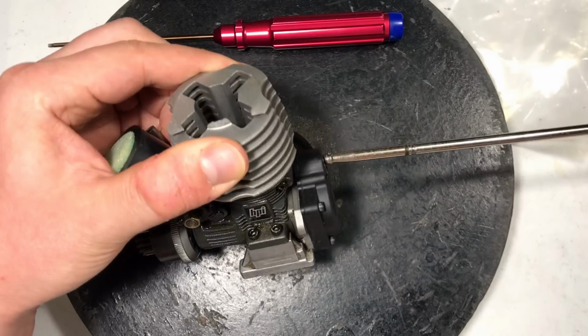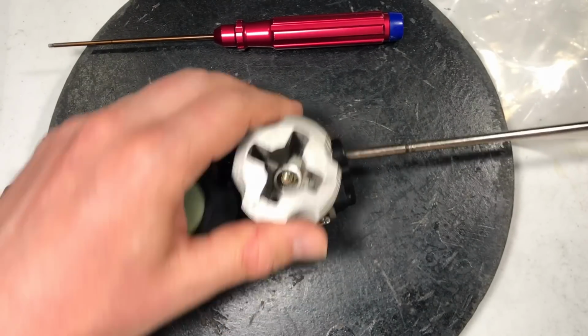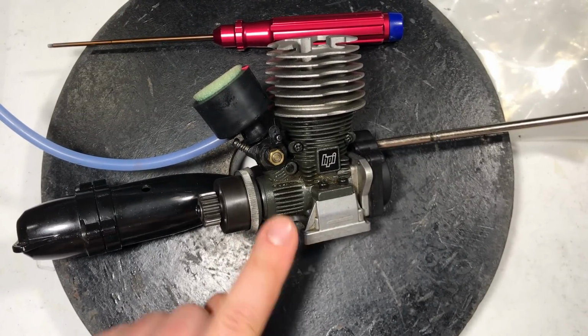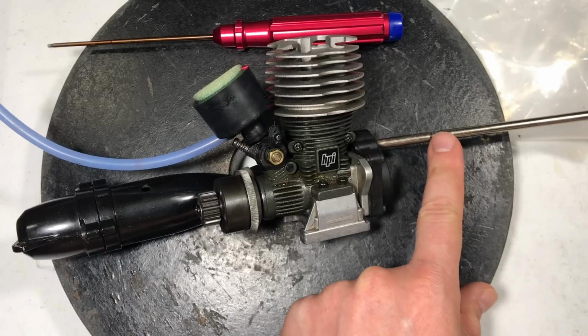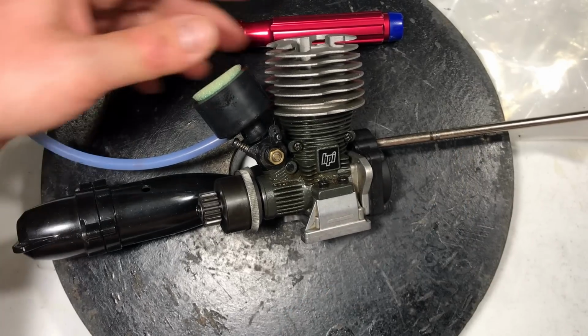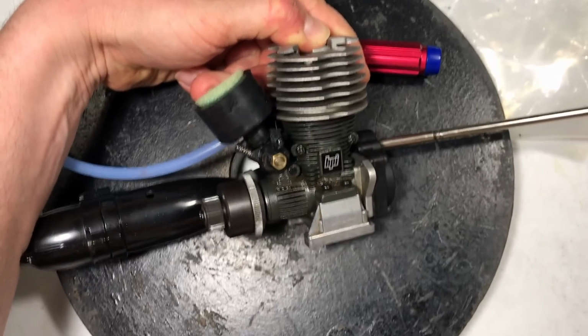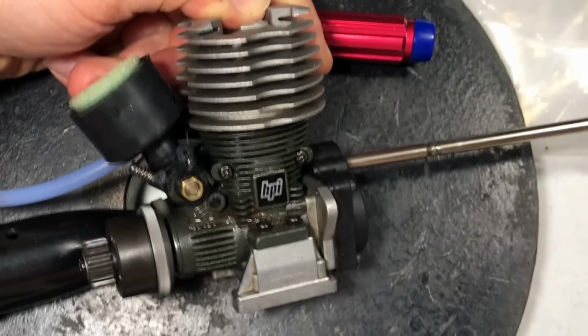So this is what happens. We're going to insert a rotor start in the back plate, right? I'm going to hold it like this. Look at the flywheel itself. Now, it should be turning each time that our rotor start shaft here spins, but check this out. Yeah, it's literally slipping. Right. You see that, guys?